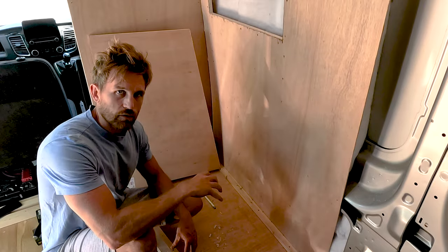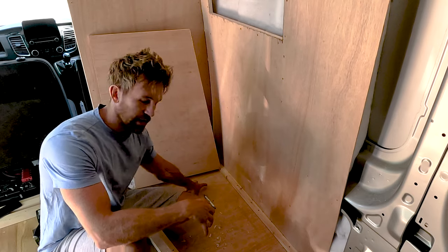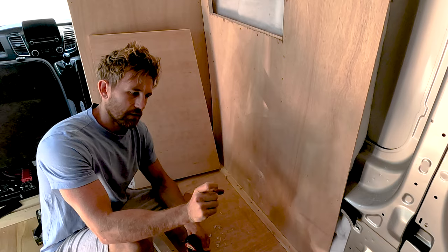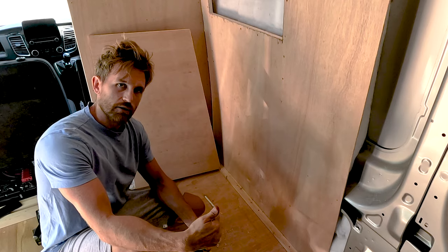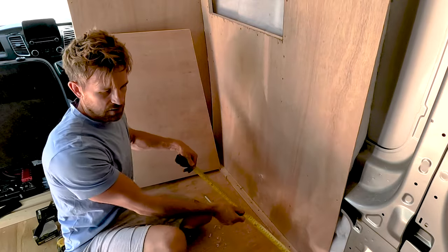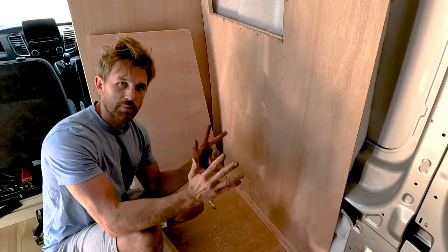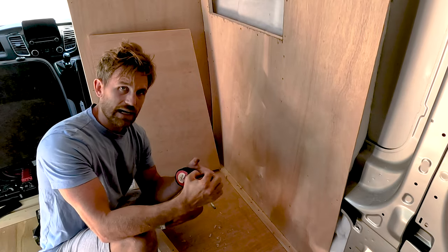So I've been looking at where I can drill out the hole for the waste. It's quite difficult at this stage to see where exactly this point is underneath the van. What I looked at was the low level indicators that run along the side of the van, and I've measured from the centre of those to where I want to put the waste. I've measured internally from the centre of that light to where I want to put the waste, and I've transferred that on the outside of the van. I can see that I'm in a nice space where there's enough room for a bit of tolerance, depending on if the hole ends up exactly where I want it.